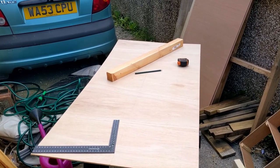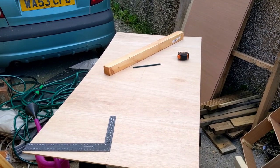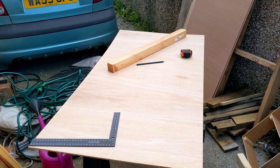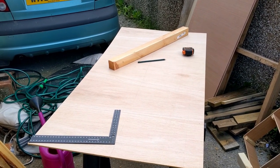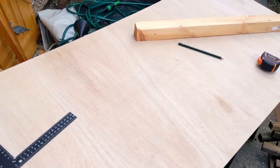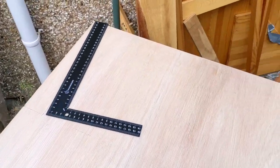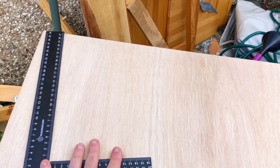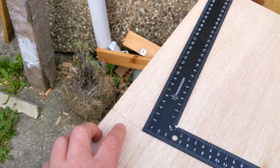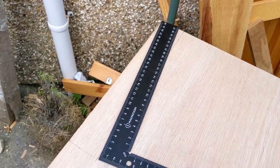I've just started laying out the boards here. This is not the transom board, but one of the mid sections — this is going to be the widest section of the boat. So this is a four-foot wide sheet by two high, and the angle I was after was a two-inch inset here for the shallow V at the top of the hull.